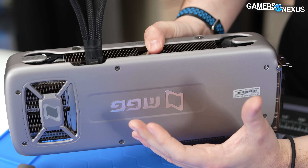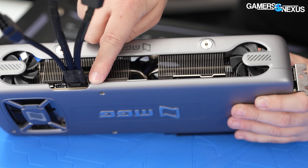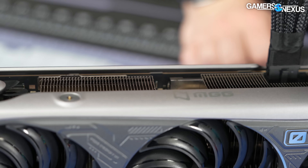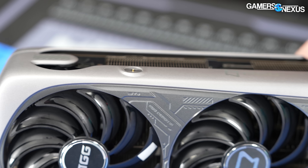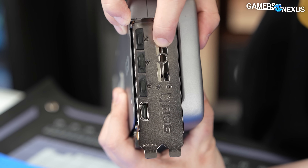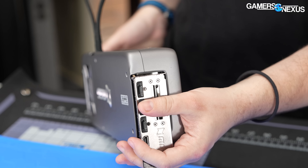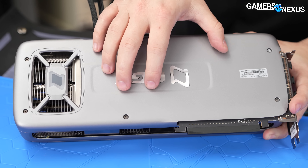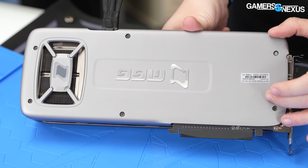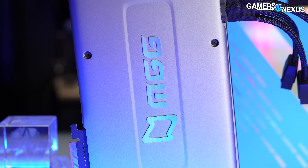This card oddly is lacking dual vBIOS. The PCB is underneath this aluminum shroud lip, and even looking into the card there's no vBIOS switch along the top edge of the PCB. For a card this expensive with this many fans, we'd kind of expect that. There's also no dual vBIOS switch on the back of the card, although it looks like they may have considered it because there's a spot about exactly the size of a physical toggle button. The backplate, though, is actually functional — in testing it's conducting a lot of heat, which is good and much better than companies that don't attach the backplate to anything. Really cool to see that from Maxsun.